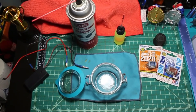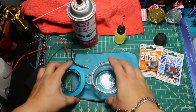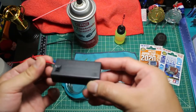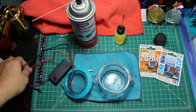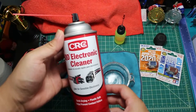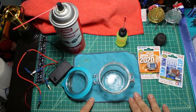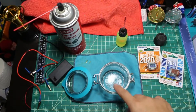These are the materials you'll need for breaking in your motors. We'll start with a glass jar — a small glass jar or whatever container you could use — a two-battery switch, some jumper cables, your CRC electronic cleaner, your comm drops or oil, and your motors of course.